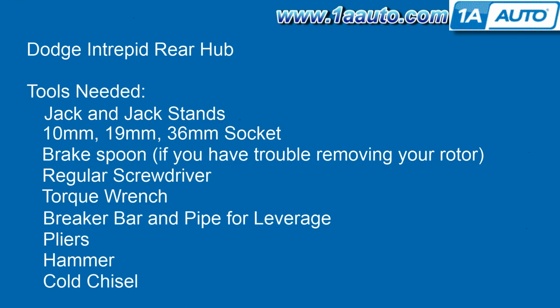Tools you'll need are jack and jack stands, 10, 19, and a 36mm socket, brake spoon, and if you have trouble removing your rotor or your drum, regular screwdriver, torque wrench, breaker bar, and a pipe for leverage, pliers, hammer, and cold chisel, and you'll see how I use all these tools.